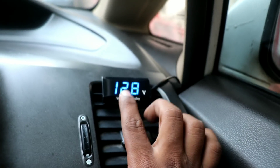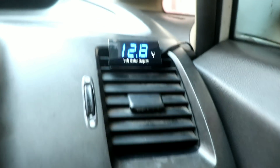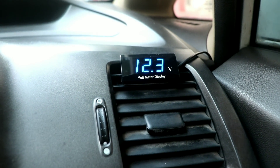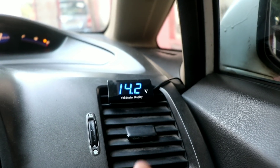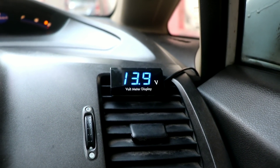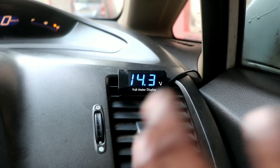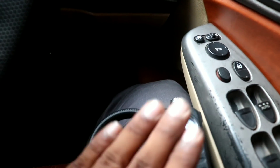Now I'll check how much load it draws on the meter. It's very loud so I can't talk much. You can see it's 12.8 volts, up from 12.3 volts. Now we'll check on the engine — how much load it draws. You can see the alternator is running and we're getting 14.2 volts. Now turning it on again, we've reached 14.2 dropping to 13.9 — so it dropped a little bit under load.